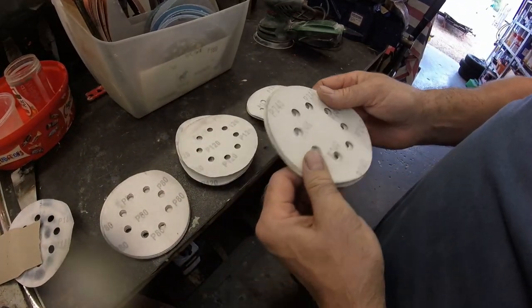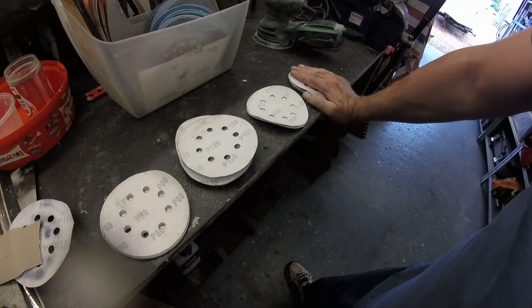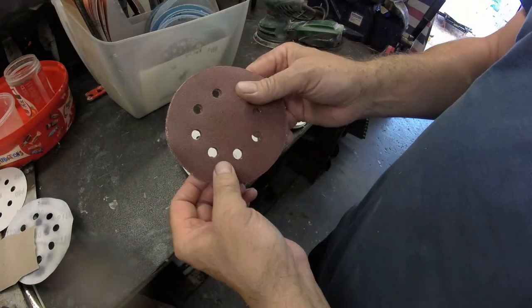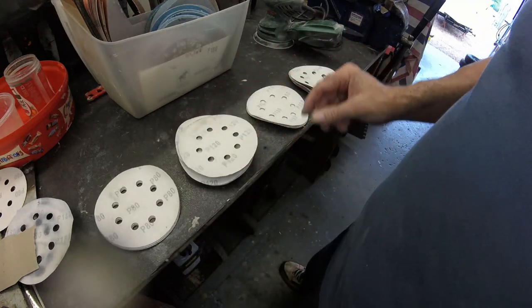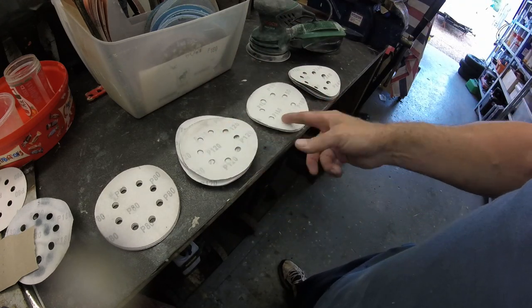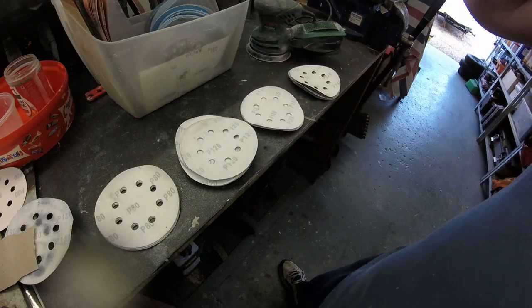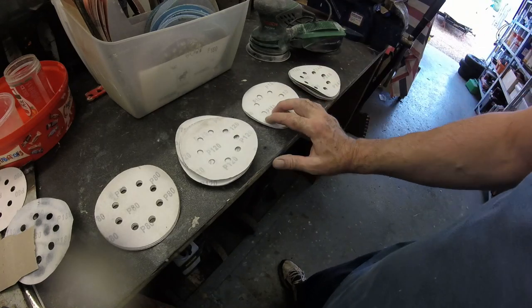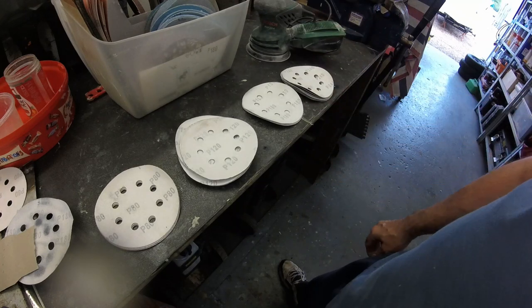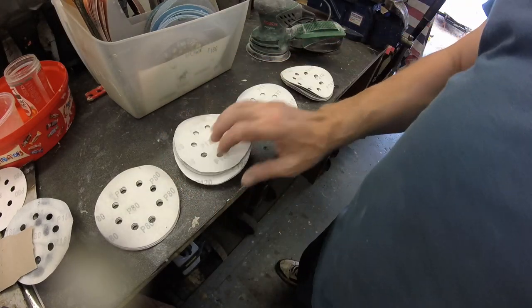Basically, I'm going to dry sand this now, so I'm going to prepare the surface for painting. But first, I've got to take off the excess of those patches that I did. So I'm going to use a P80, which is just about enough, I think, to take off the excess. Then I'll do the whole lot with the 180 or 240, 180 where I feel that there's a few hard spots, probably where I've been filling in with the epoxy filler, and then I'll do a quick go over with the 240 to prep the area for painting. It's been raining all day, so I'm probably not going to be able to paint today, so just a case of a bit more prep.